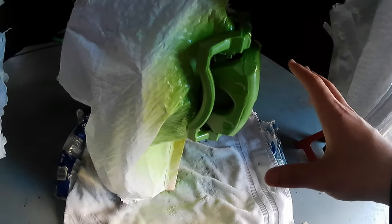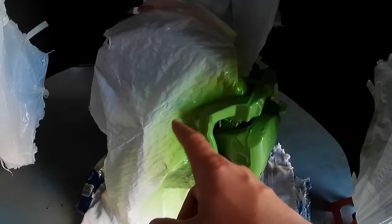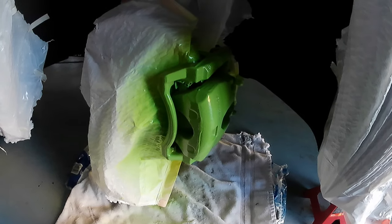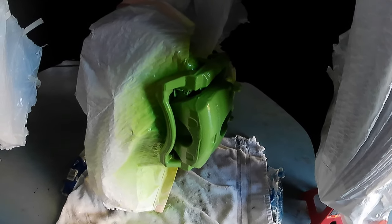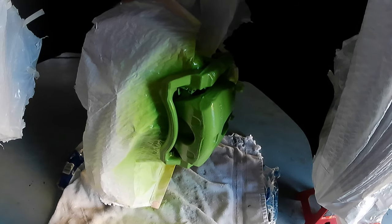And okay, friends, so when you finish painting, it's gonna look something like this. Beautiful finish, sexy it looks. So guys, when you finish, take out all the masking tape that you put on the brake caliper, put that tire back, take the jack stands out, take off the parking brake, and you finish, guys. So let me paint all the brake calipers on my car, my Camaro 2021, so I can show you how the car looks.